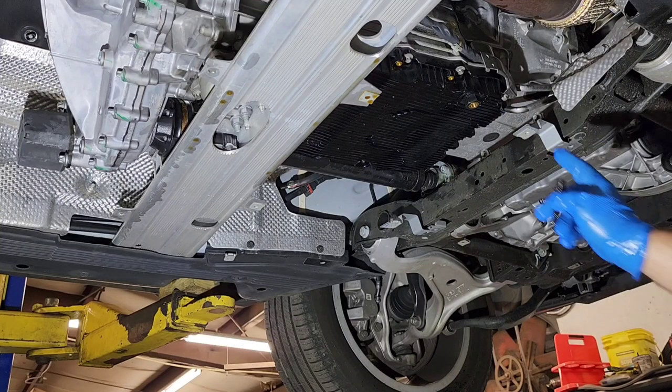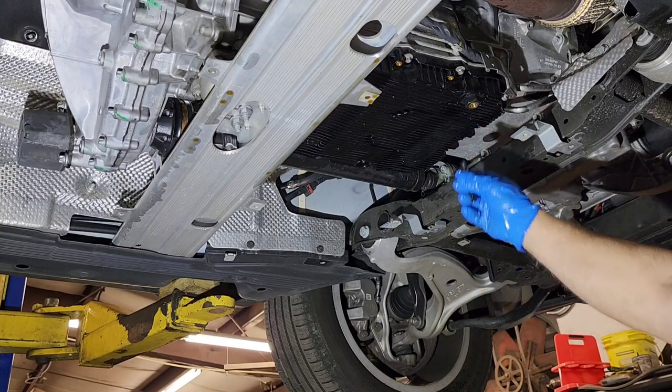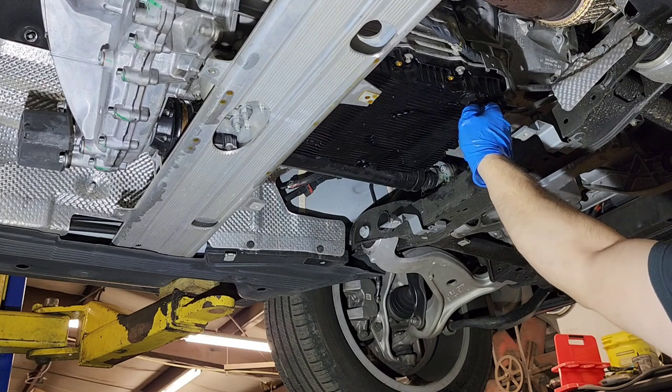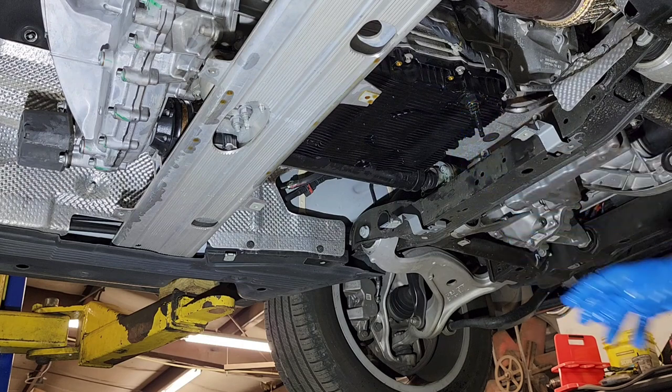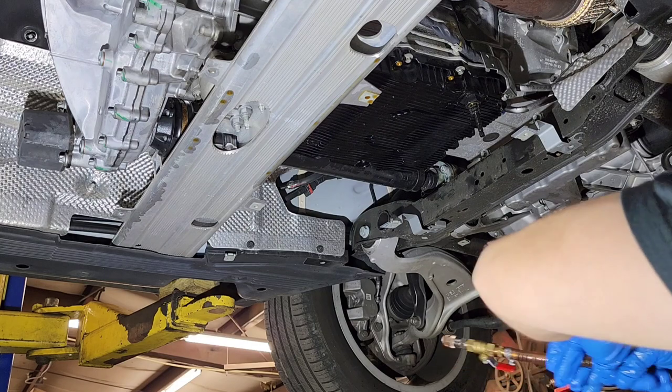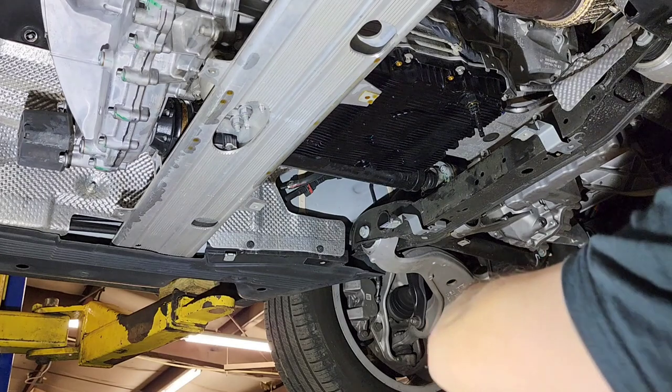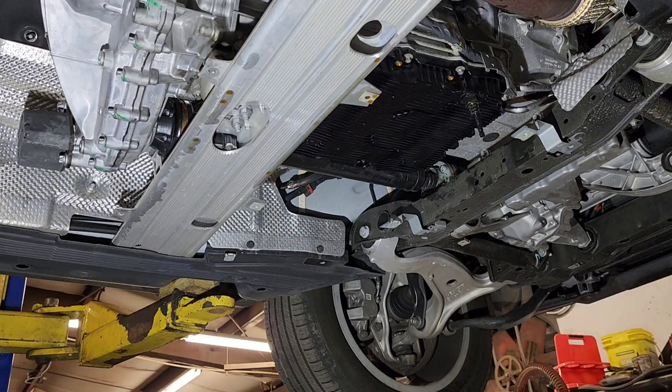As I said, you install the adapter, and then I need to install a second adapter, because I need to attach my electrical pump. And there we go, we'll attach it here. Actually, before I attach it, I need to run a little bit of oil through the system. That's why you're supposed to buy one extra bottle to clean the system out of the old oil.